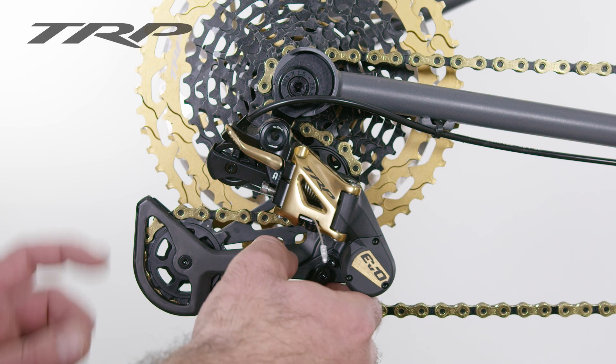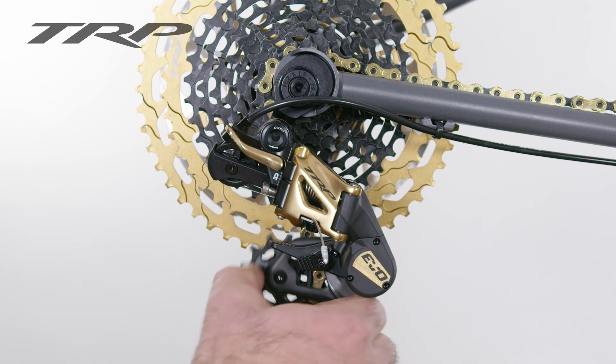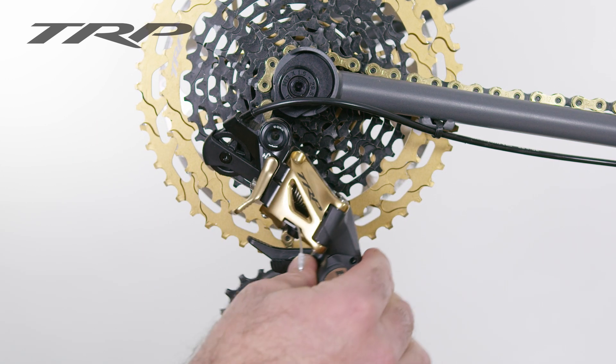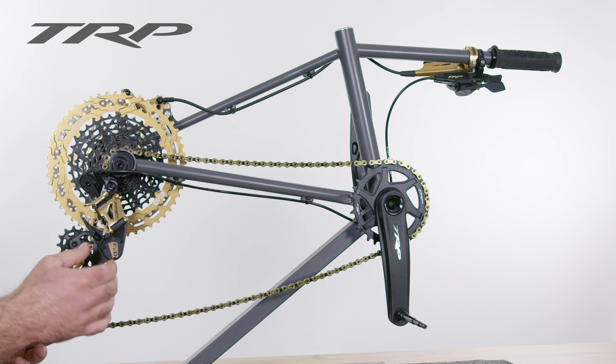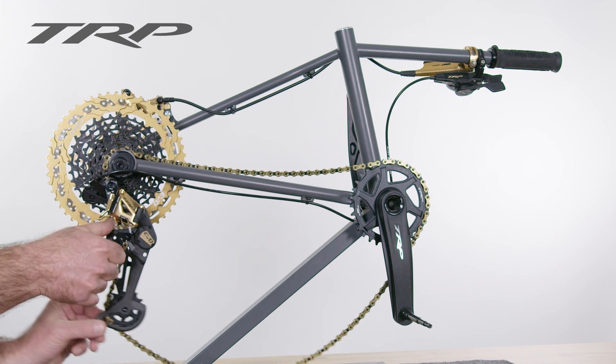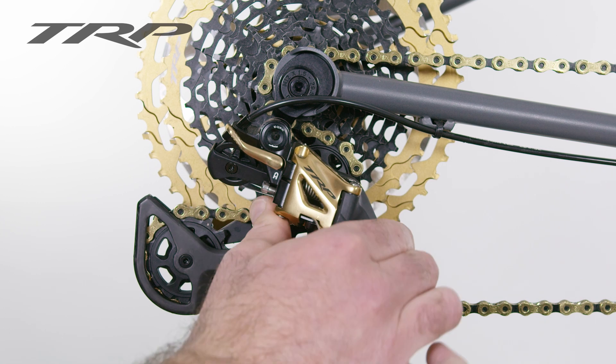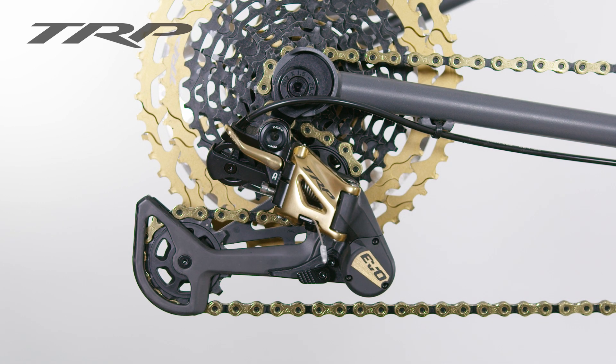In conjunction with our cage release, if you do release the cage to get the wheel off, you can then undo the haul lock and pull the derailleur back. That'll give you enough clearance to get the wheel out. And then when you're done, you can go ahead and re-engage the cage and then re-lock your haul lock back in place, keeping the derailleur nice and stable.